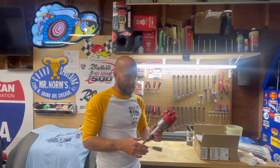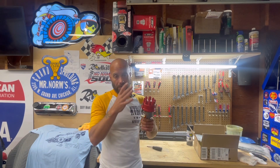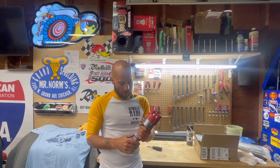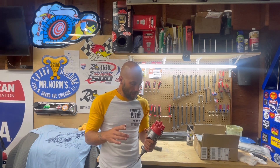Overall it was a really good night. But where I'm going with that is: these old Mallory dual point distributors — any distributor per se — you've got to set the dwell on it. There's different ways to do the mechanical advance or vacuum advance, and you can do that by putting it in the car and tuning it, or you can do it a different way. Back in the day there was a company called Sun that made all kinds of diagnostic equipment for the automotive industry — a really good brand, and coincidentally they were made in Chicago, Illinois. So it wasn't surprising what I ended up purchasing was found in Chicago, Illinois.